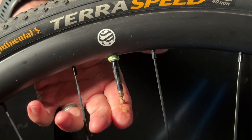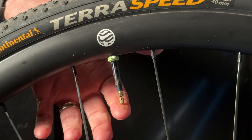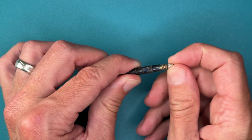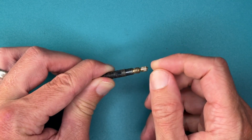If you listen close here, you can hear that the valve isn't naturally closing off, so it continues to leak slowly even without holding it open. Looking at the valve core itself, the stem is very gummy in its movement and feel — I'm not sure how well this translates to video, but it's on its way to failure.